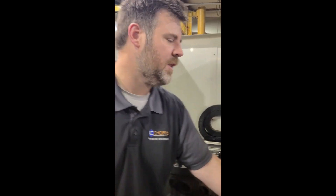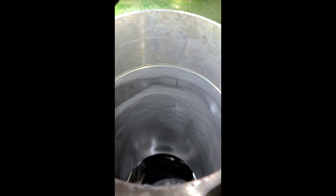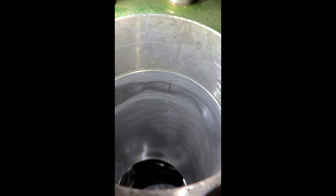There's cross-hatching above and below it. Now the diameter of it, when the torque plate was not on it, showed to be the same. If the camera wants to come in here and take a look — you see that shading, you see the cross hatch above it and the cross hatch below it.